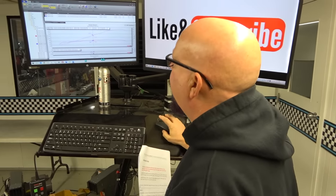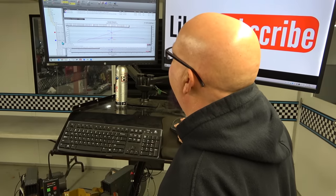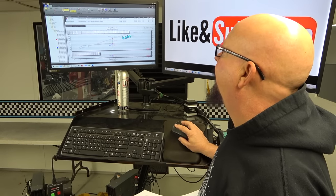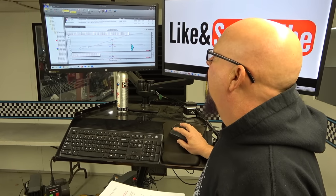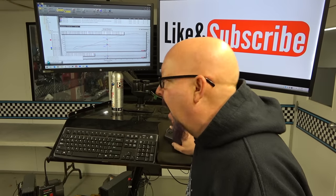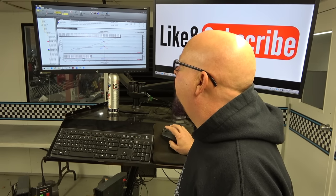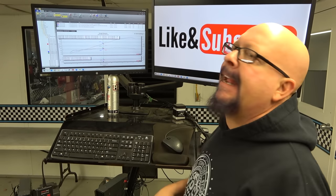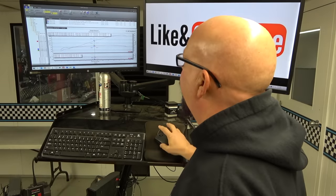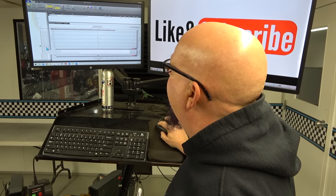So first thing we're gonna do, we're gonna go in here and optimize everything for the conditions, still with the pump gas. I don't even need you to zoom up on this. It didn't really do anything. We picked it up a little bit. We ended up leaning it down because the dyno was crazy. Almost 91 degrees in the dyno. The absolute pressure was down. The humidity was up. The correction factor was up. Everything about this time to test these parts sucked, but we're doing the best we can. So let's start off with optimized. And now let's go ahead.